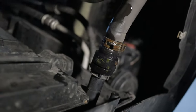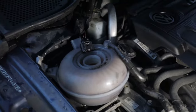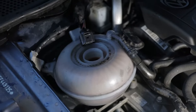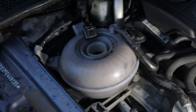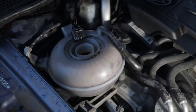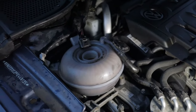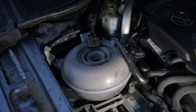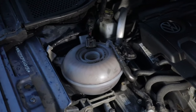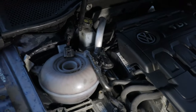I've now drained through both hoses as much fluid as I could. Once the bigger hose was removed and fluid had drained, I used a garden hose to fill the radiator with water — you can see dirty fluid coming out first, then plain water starts running clear. I ran it for maybe a minute or two bottles' worth until the water coming out of the black hose was clear. Next I'll put all the hoses back and run the system with distilled water — that's the preferred way, though tap water works if you can't find distilled.